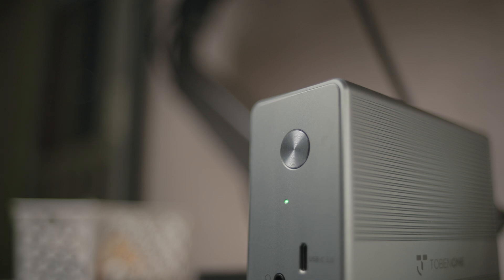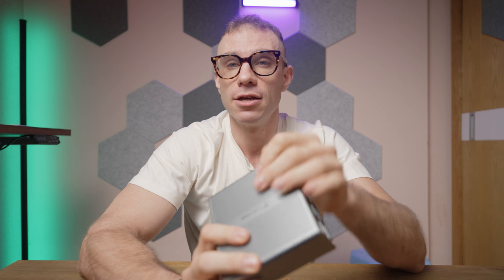Another thing: if your computer requires more than 100 watts of USB-C power delivery, this is also not going to be for you. We now have newer USB-C power delivery protocols — USB-C PD 3.1, and we're coming close to 3.2, which will do 140 watts out. For some laptops that might have a dedicated GPU, this is probably not going to provide enough juice. It provides enough power for my MacBook Pro even on high power mode, though I'd get some extra turbo boost if I used the MagSafe connector. I haven't had any issues with my computer drawing from battery power to get stuff done.